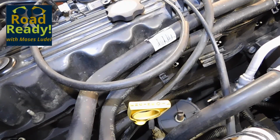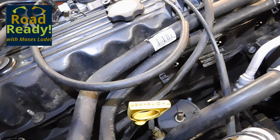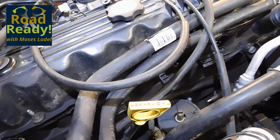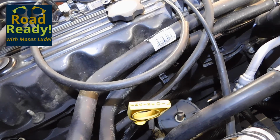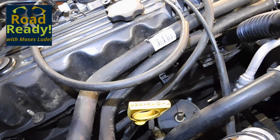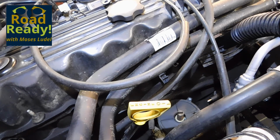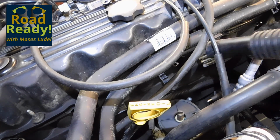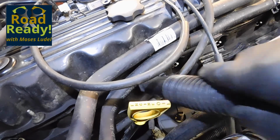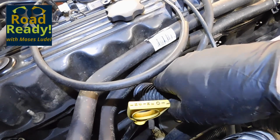Before removing the spark plugs, I always use a shop vacuum to vacuum around the spark plug areas. This is assurance that no debris will fall into the engine when the spark plugs are removed. I do not advise loosening the spark plug some and cranking the engine over to blow debris out. This always runs the risk of dislodging a spark plug under force.